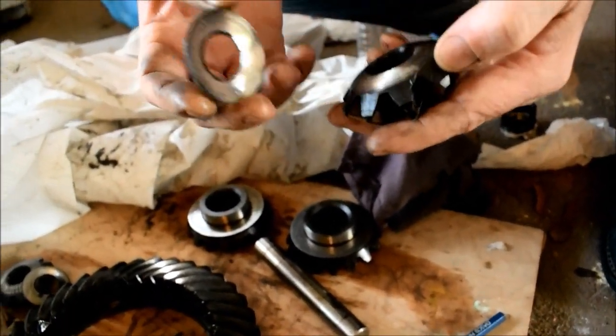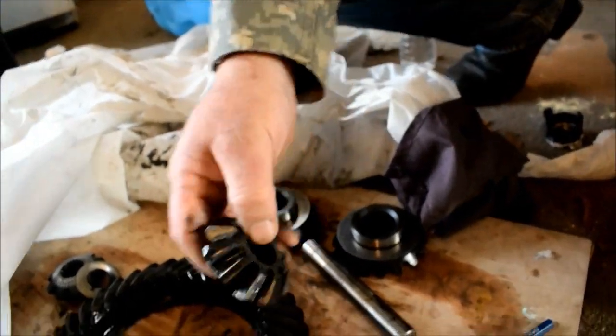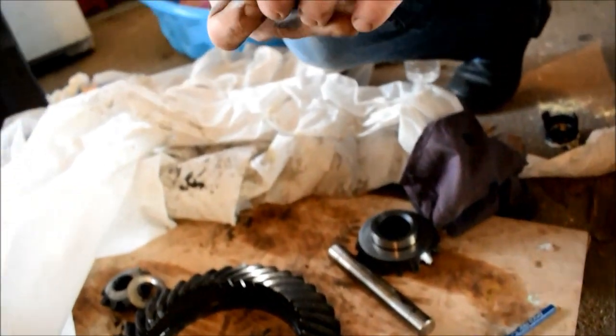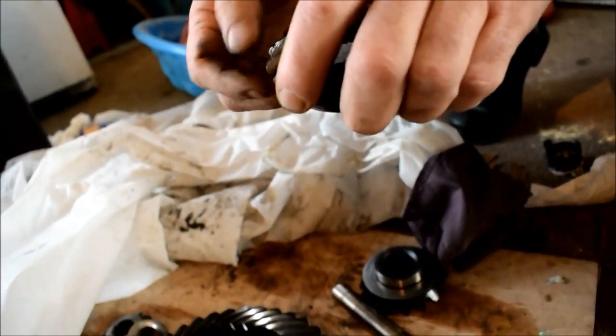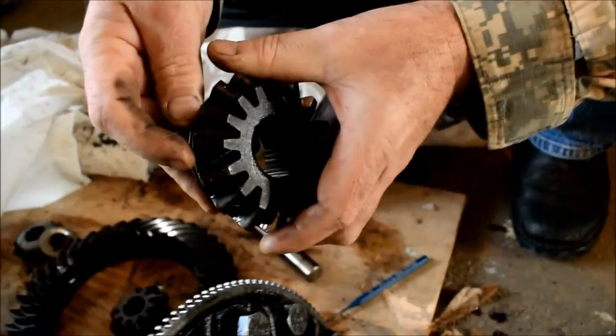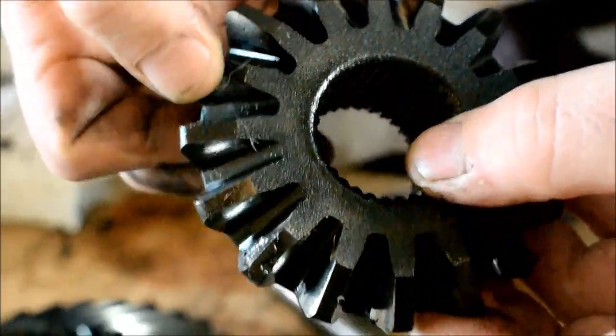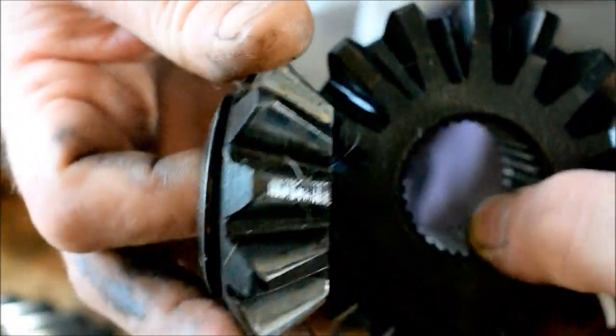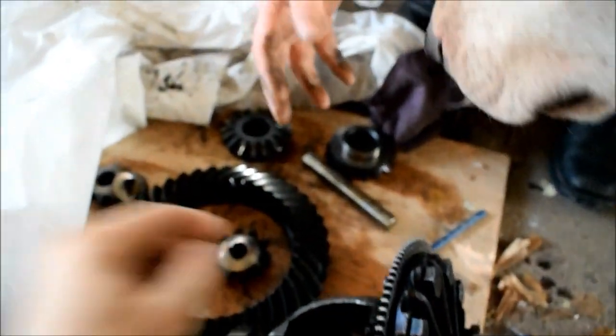So this is the top gear. These gears, they're all spider gears. Spider gear sets, what we call it. All right. Look at the chips on the teeth right here. You can see the chips, how bad they are, and it's full of dog hairs, but that's going to get off in gasoline. And they're all chipped right here. So they were riding together, creating a serious vibration in here, which was causing the rear end and the axles to shimmy. And there's a lot of play between the pin, too, that held them all together.